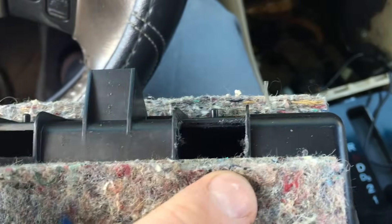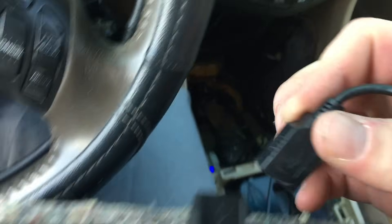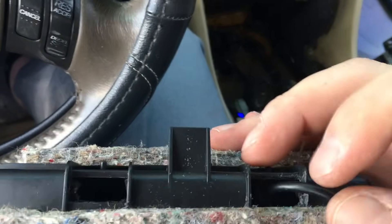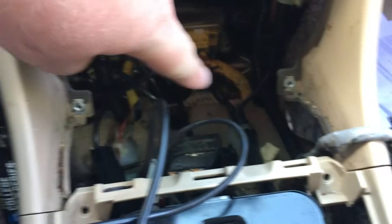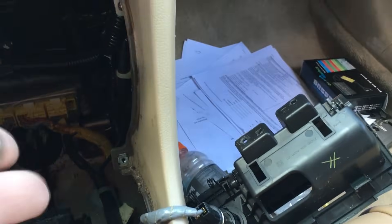Since that's all plugged in, I've taken this compartment and flipped it upside down. On the back here there are these two little holes, and this one I shaved a little bit bigger using a file, so this little USB port fit right down inside there. Followed by it, I'll do the aux cord like that and feed those through. Now I'm going to put this pocket back in and reattach the two bottom screws so the pocket is now secure, and start reassembling.